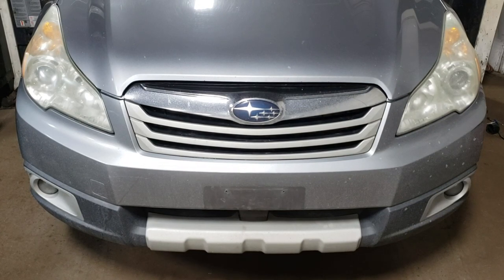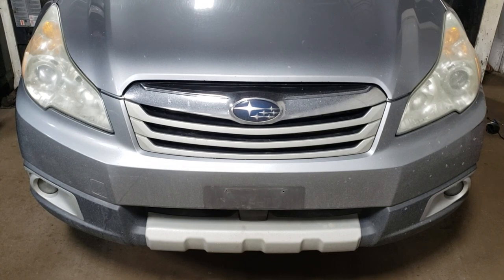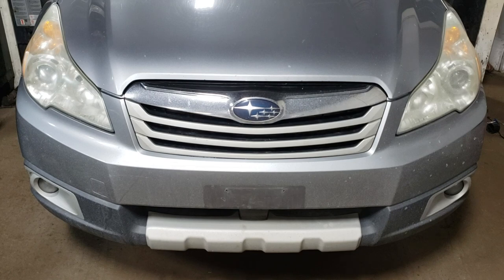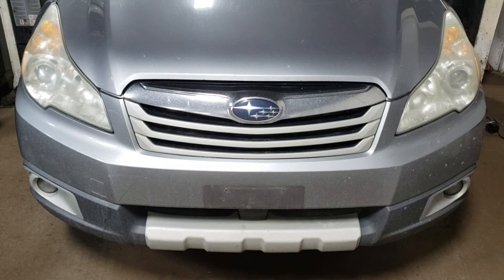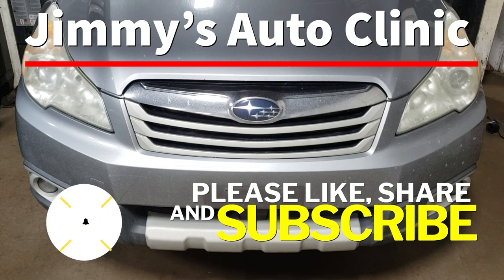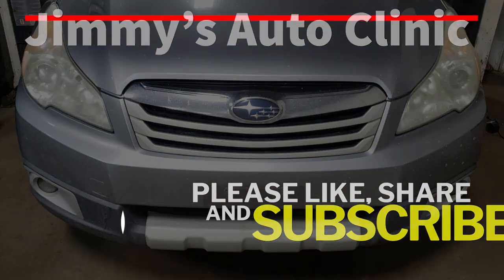The last step and most important step is that you go ahead and pump the brakes before you take this thing for a test drive. Make sure the pedal gets hard under your foot. If it does not, inspect and see what may have gone wrong. Make sure the brakes are engaging before you take it for a test drive. Once you're on the test drive, listen for any weird sounds. Make sure you give it some time to bed — it will take some time to go back to its normal feel, usually in the first few applications of the brakes, though it can take a bit longer depending on the pad material. Hopefully you found the video entertaining as well as insightful. If you did, please like, share, and subscribe. Don't forget to hit the notification bell so you never miss one of my new videos. Thanks for watching — we will see you in the next one.